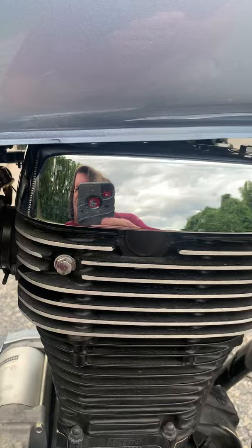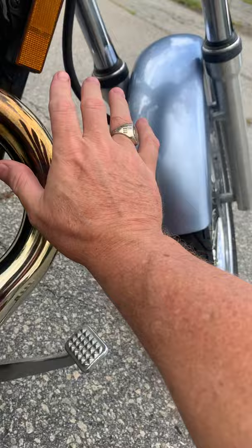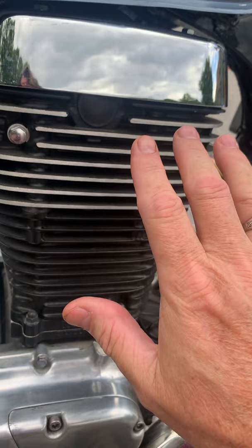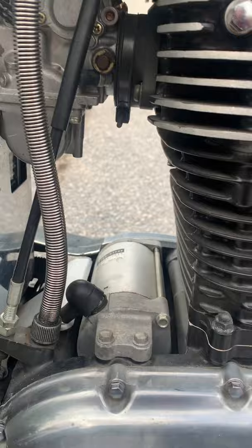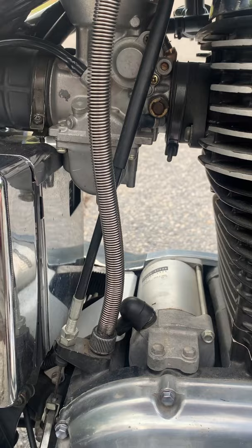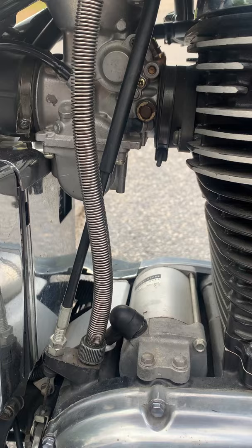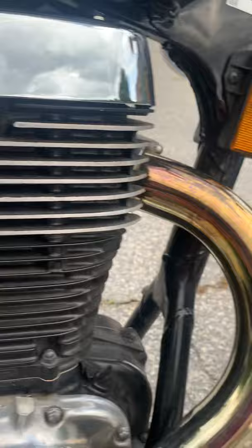Let me show you the single — this is a 650. Look at the scale of that thing, that is a massive cylinder. What happened with the petcock: it actually picked up a vacuum — right here, you can see I have it capped off. There was no off position on the switch; off was turning the engine off. But over time, that diaphragm leaked and would rupture, sucking raw gas right here at the pivot for the butterfly, and just dumping raw fuel into the intake. You can see the result — the soot back there.